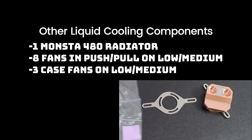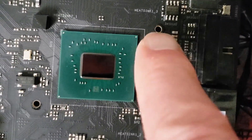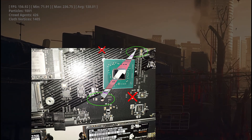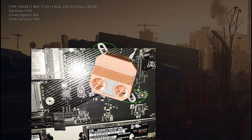The pure copper water block comes with two different mounting brackets. These brackets are diagonal brackets, so you only have to have two connection points to match on your chipset heat sink screw holes. Unlike a GPU or CPU water block where it usually attaches with four screws around the processor, this one just needs two connection points to line up. If you can get two of them to line up diagonally, then you can attach this to your motherboard.